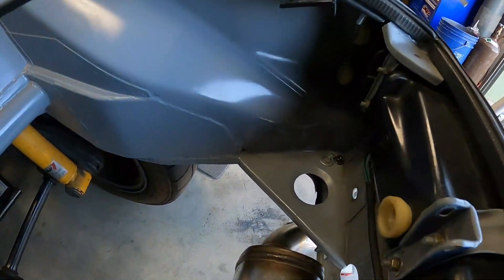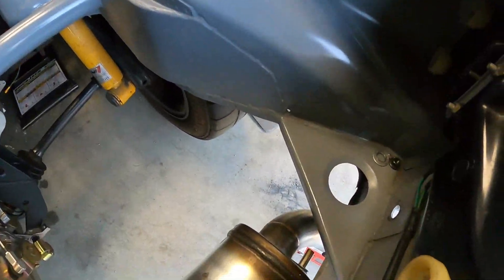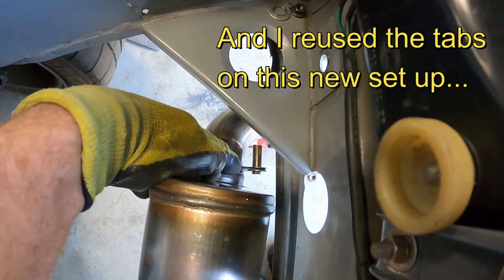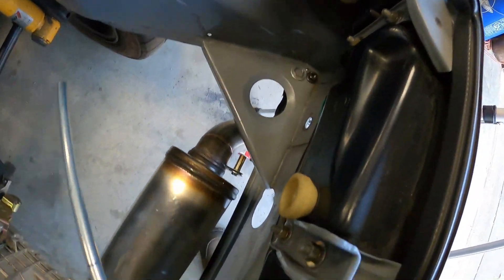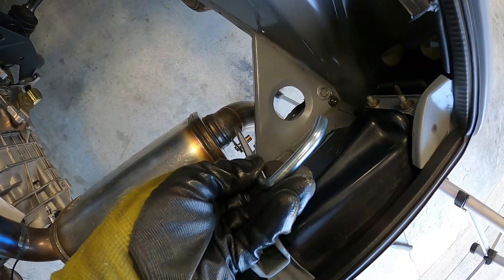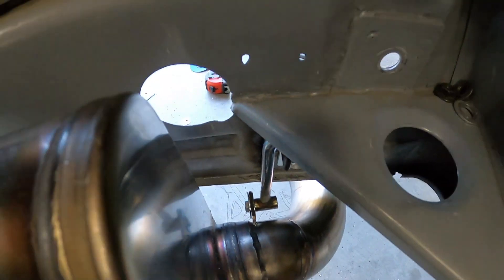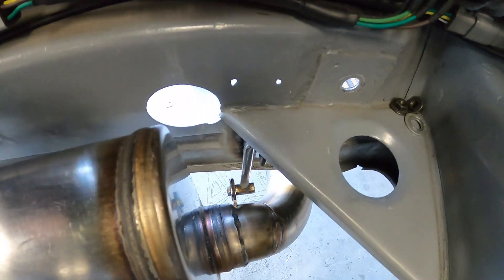Here's the process for making these hangers. I just welded on some nuts, figured out the location for the bracket — it's tucked up in there as tight as I can get it and as far to the inside as I can get it. I actually sliced the tabs off the muffler that were already on it, this one's just tacked on, and I've got a threaded bung positioned. I had the hanger in there, marked the height, sliced it off, swung it back into position over the bung, let it sit in its natural state, tacked it, and then everything gets fully welded. It's in single shear, but it's really not doing much, and with the rubber mounting that tab's not going to take much of a load.